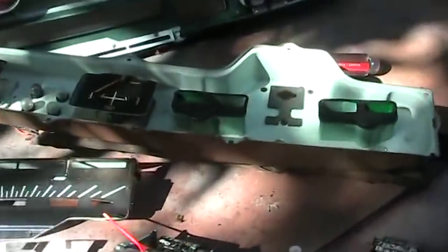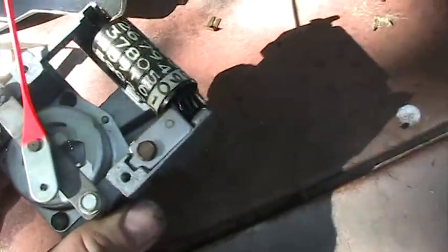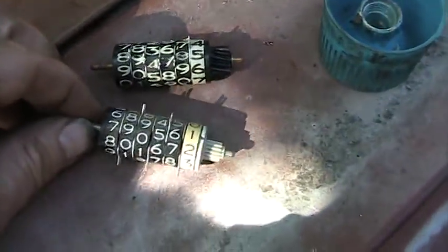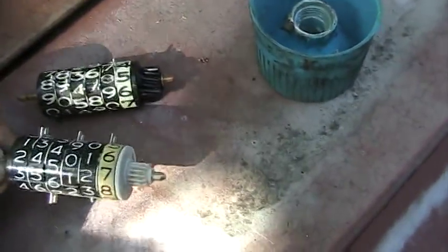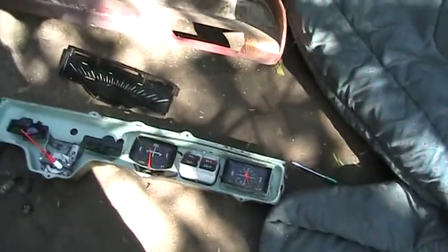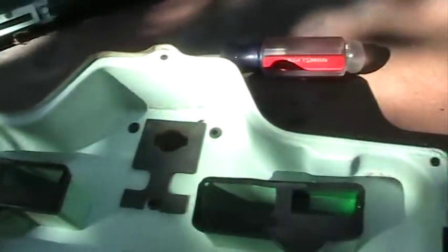While I've got the speedometer cluster out, I thought I'd replace the numbers and the actual odometer themselves. My old ones were all messed up. This set of numbers is out of like a '78 Malibu, but the teeth on that end gear are slanted on the '63 Chevrolet. So I had this other speedometer I got out of a '63 in the wrecking yard and it had better numbers on it — not much better. But talk about a jigsaw puzzle.